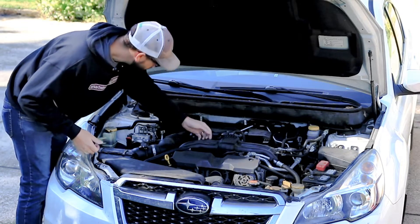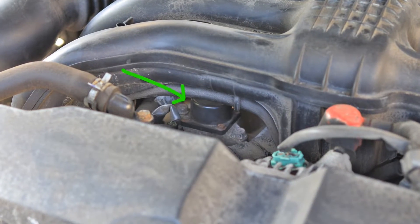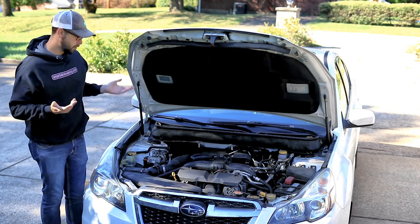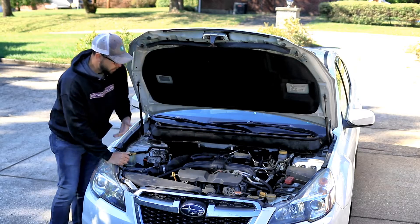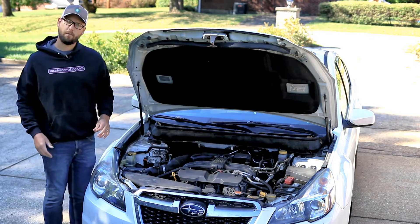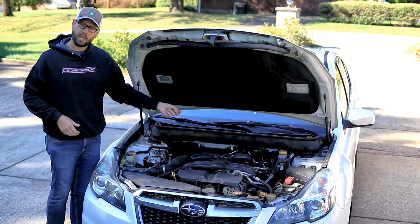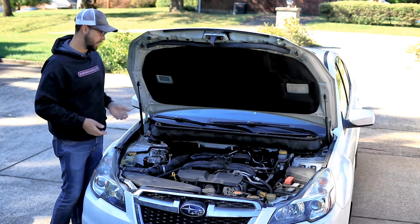It's right here — if you look at where this splits, directly underneath there. It's held on by two 12mm bolts, so just a 12mm to take it off. The manual would probably say to take the whole intake manifold off, but you can actually get to it with a smaller ratchet — you can wiggle your hand down in there and get to it without taking off the intake manifold.